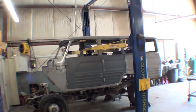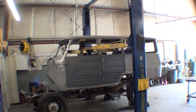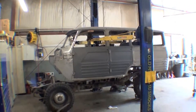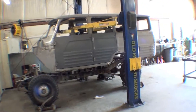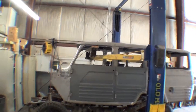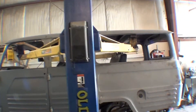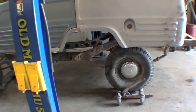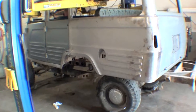While we wrap up some minor details on the interior, the biggest thing now is we want to get that done, get the body on the rotisserie, finish up the underneath welding, and set up our master cylinder and things like that. We really need to complete the chassis to finish this up. So we feel we're at a good point to roll it out. You can see we lift it via the strongest point in the roof with two-by-fours and wood so it doesn't damage anything. We're going to slide it out on the skates — it's half out right now — and we'll lift it a little more and yank it out of there.